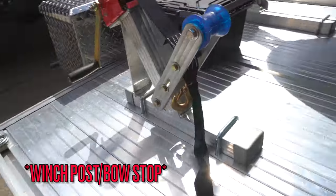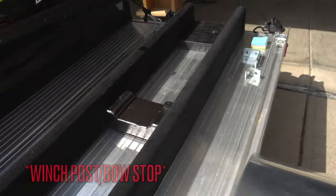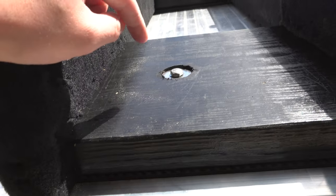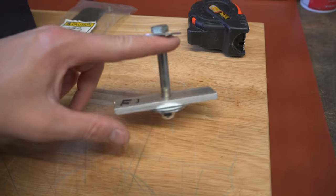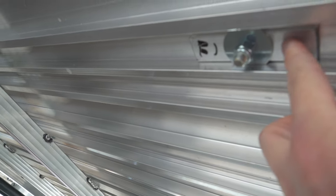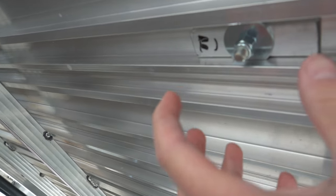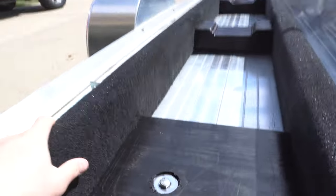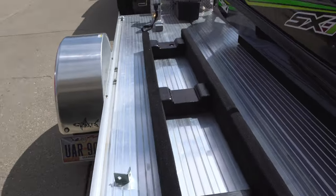We got the tongue fully mounted and the two bunks and this bunk mounted. And what we did was, I'll show you kind of the bolt hardware setup. We have a long bolt with washers on both sides. And besides the washers, we also put a support bracket on the back, to give it an extra strength, and looks kind of cool, but mostly to give it extra rigidity and strength for the trailer. So we're putting less stress on the trailer.